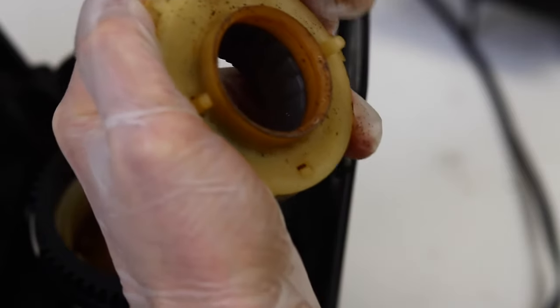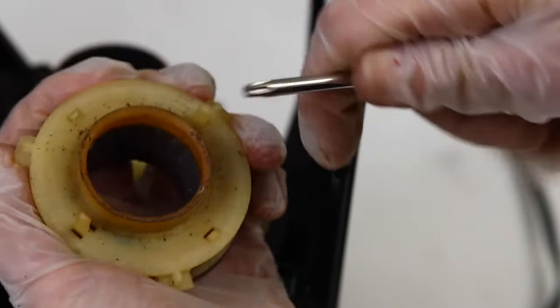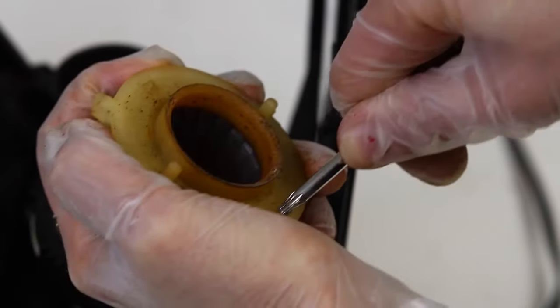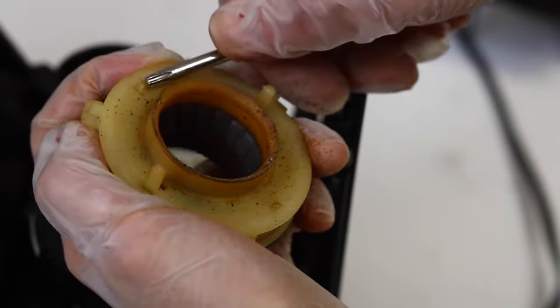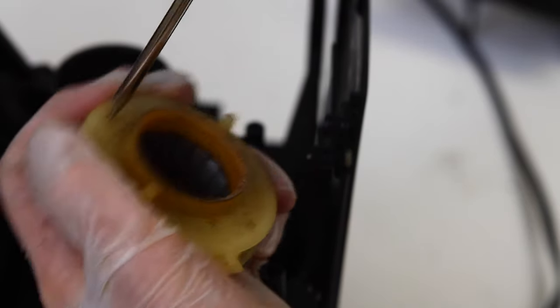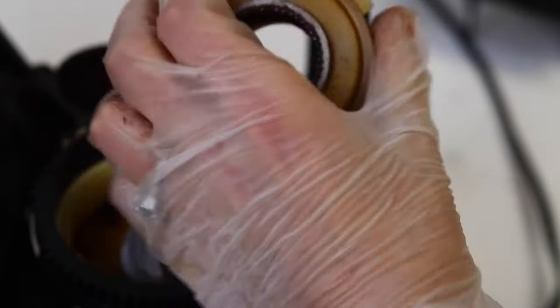Press these two points — this little latch is holding on, and it's all plastic, so you don't want to press too hard or you will break these clips. Use your T10 to press a little bit further, then move on to your straight pick. Be careful not to stab yourself with the pick. Make sure you're getting a clear view of this — flip the support over and pry open the bottom piece that holds the top burr in place.